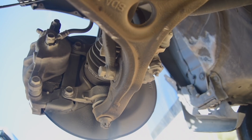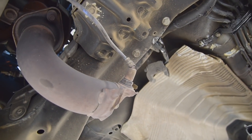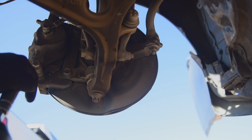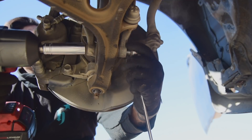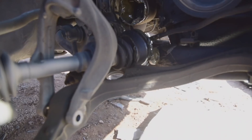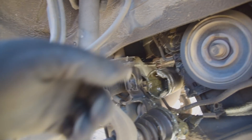And then you'll see our clutch fork there. We'll take those 17s out. Then we'll work our way over here to the exhaust — that's going to have to be removed. As we drop the subframe, you'll see that's going to catch on there. But check that out — it looks like they left our oxygen sensor in place, though it does look damaged, so maybe we won't take that. I've had luck not having to take the cotter pin all the way out — if I just clip the ends off here and put my impact gun on it, just work it off that way. Looks like that one already came out. I was working on the passenger side first, and this was the side I was most concerned with because it also had the intermediate shaft. The boot there was already torn and everything fell out.